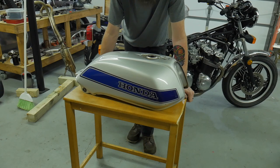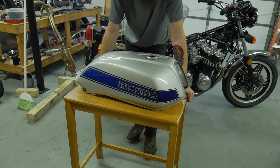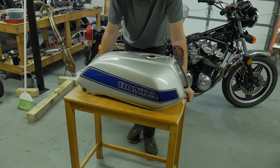Running a thimble or a shot of two-stroke oil added to your full tank of gas is not going to damage your bike. We're talking about a very minute amount of oil that is supposed to be burned in a two-stroke bike — it's not going to harm your system. If you run a high-oil mixed gas, you will likely carbon up the cylinder a lot faster than normal. But adding a little shot glass or thimble of two-stroke oil to your gas every couple of tanks is what I would say is the best route. If you're going to store the bike over the winter for four or five months, fill the tank up full of gas — the more you can keep that metal covered with fluid like gas, which is a petroleum product, the better.